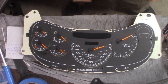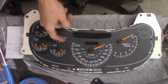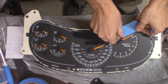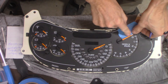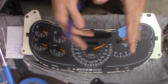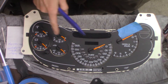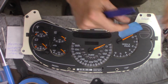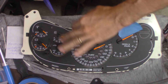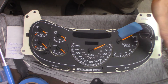So I'm doing this after I had it back in the truck, because I forgot to do something - which is kind of dumb. These have a sweep to them. You sweep them all the way down to their resting position, and then before you take them off, mark that position with a piece of tape or take a picture. I think marking it with a piece of tape is probably better. I didn't do that. I have a scanner and I could look at my scan data and see how much I was off - I was pretty close except for this one. I have to now adjust them all. Mark your resting position, and when you put the new ones in, set the needles right back to where you marked - that way you'll be exactly where you started from and you won't have to adjust them.